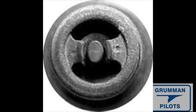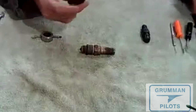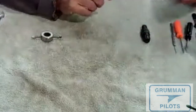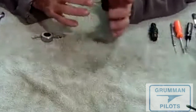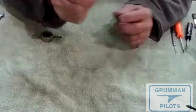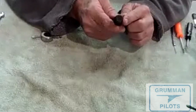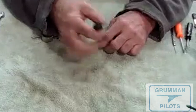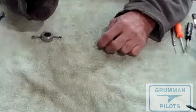This plug is still good even though the resistor is bad, so those go back in the trash. If you have a bad plug, sometimes the threads inside your cylinder — which has a Heli-Coil — can get a little messed up. You can get a thread chaser, which is nothing more than a set of screws that match the spark plug threads with a couple of slots to pick up debris. This is the 14mm for experimentals/cars, and this is the 18mm for aircraft.